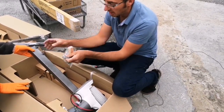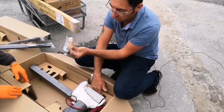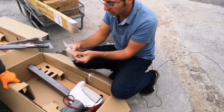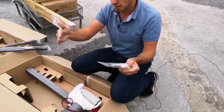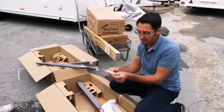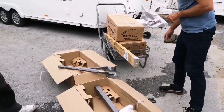Little wooden block, that's going to actually set our distance from the tyre to the roller, so that will make sure that we're at the right gap. So when we put it on, it's got the right pressure on. If it's not the right pressure and both sides are uneven, that's when we'll see that the motor mover will start turning in either direction as we're going straight. So they do need to be quite close to perfect.